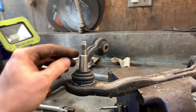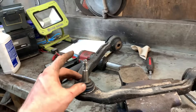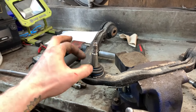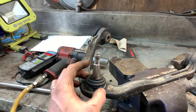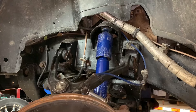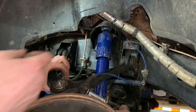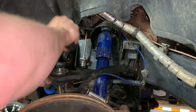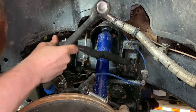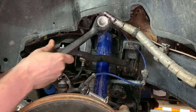That's all back together — let's go bolt it in. There's no grease in it now, so I'm going to fill it full of grease once it's bolted in so the boot is squeezed down. Lots and lots of grease around the ball and the bushing. When it squeezes out a little bit, we know we're good. I'm going to max out the camber on this right away when I put it in, because I know I'm not going to have too little camber for sure.